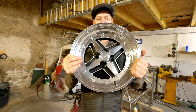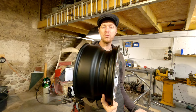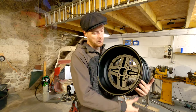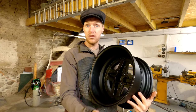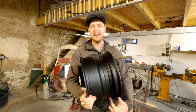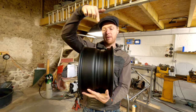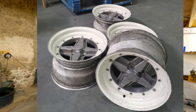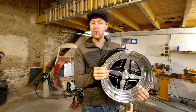The Porsche wheels were 14 by 7, but the center of a Porsche wheel bolts on the back, as most three-piece modern wheels do. The old-school BMW 2002 wheels fit in the center as a one-inch spacer. So we have a five-inch back, a one-inch center, and a two-inch front, making eight inches.